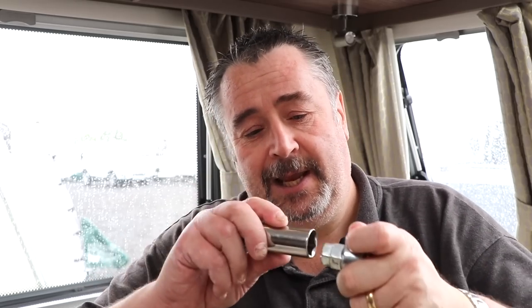And there we go — I hope that's useful for you. You can probably see I got caught in the rain outside and it's still persisting right now. That's hopefully as much as you need to know about torque wrenches, but there are a couple of things I just want to cover off. You may have seen me using a locking wheel nut on our wheels — nothing to worry about, most Baileys have these, so I need to install that first before attaching the 19mm socket. Also, your caravan may not use a 19mm socket — check your handbook if you have one to make sure you have the correct size. I use a long-reach socket to get past the spat on the side of the caravan, as the wheels can be surprisingly far in. The torque wrench I have does come with a short extension bar already — all you need to supply is the correct size socket, which in my case is 19mm.